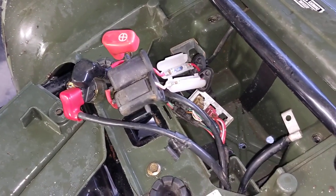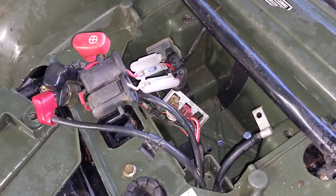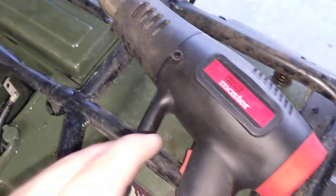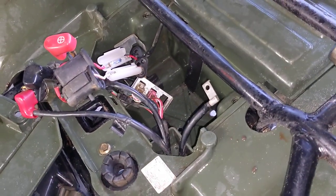So I'm going to do that for now. You should do this before you start water riding, but if you're like me, you fix things once they're broken. But it wasn't even broken - of course, it's a 300, I have a kickstart, so it's kickstarting on the first kick no problem. Heat gun is key: clean it all with degreaser and water, then heat gun all the moisture out, then dielectric everything, put it back together and it'll be good to go.